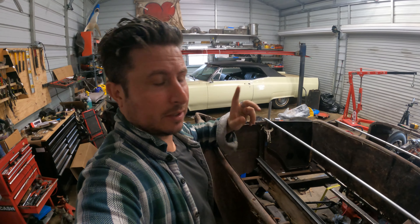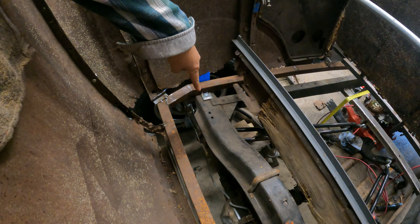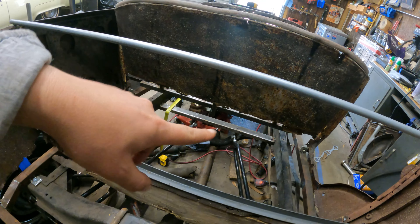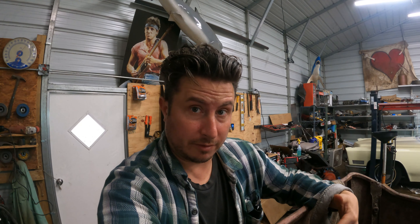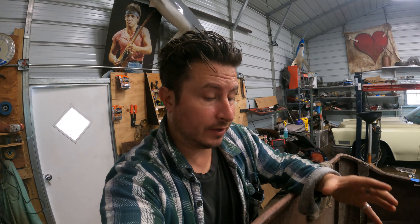For those of you warning me while you crack a new beer — you're right. I went ahead and ran diagonals. I jammed the tape measure as far as I could into the corner of the frame and ran it to the intersection of the crossmember and the frame on the other side. We ended up with 47 and a half inches both directions, which means my crossmember is square to the existing parts of the frame — which is significant when you're trying to do alignment-type work. Now I'm going to measure the mounting points on the crossmember and continue the hunt.